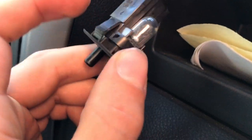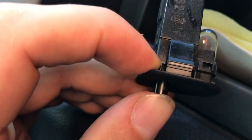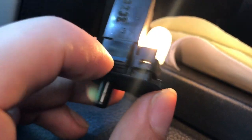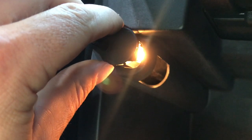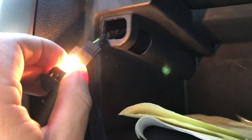Here's the little peanut-style bulb I was talking about. You can see these two latches — that's what was holding it in. It has a latch at the top and a latch at the bottom. You just use something like a little pry tool or a flat tool, take your time, and it'll come out no problem. Once it's out, wiggle the bulb out without burning your fingertips.